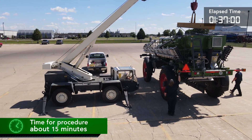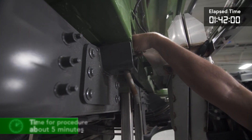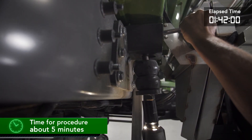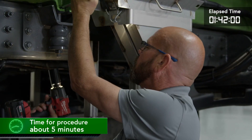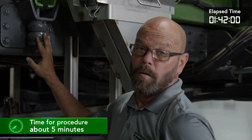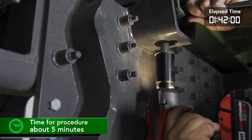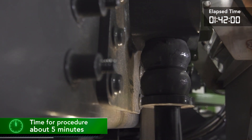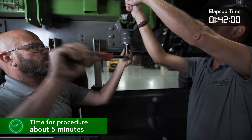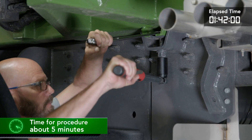With the Air Max Precision box now on the chassis, we will first install the system mounting bolts. These are installed and torqued to 89 foot-pounds. We have two on the left and two on the right-hand side. We'll go around and put the first nut on all four corners, then come back and torque each nut to 89 foot-pounds. Then we come back with the second nut, run it up, and then set the torque on those.